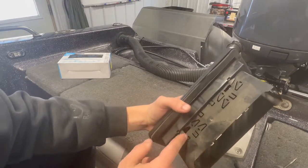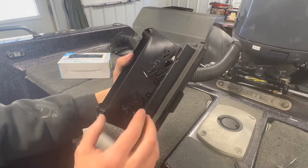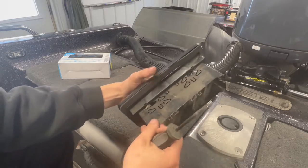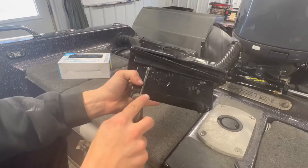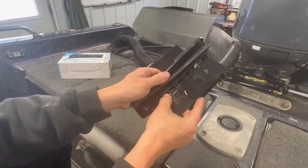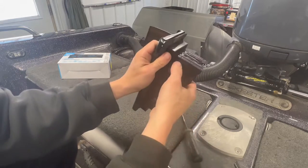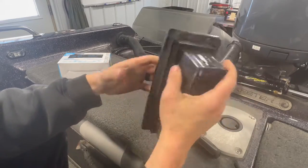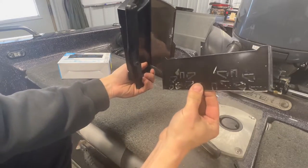Now this is held in here by these little locking tabs. So all you've got to do is bend them back down and you'll be able to remove the old housing. They're not too tough to bend — once you get them started you can just do it with your finger. Now if you're installing the same brand radio that you're removing, you don't have to do this step — the new one will slide right in and clip in properly. But we're not. We're removing an older Jensen and installing a Boss, so they're not the same mounting clips on the side. So we've got to go ahead and remove this, and then it just kind of wiggles out once you get those tabs bent back down. So there's the housing for the old radio.